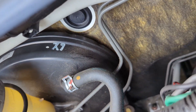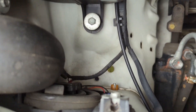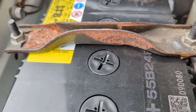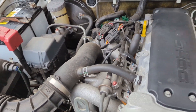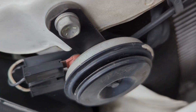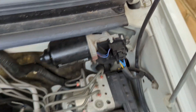Sometimes on UK ones you can see the master cylinder with corrosion on it — nothing here. Every pipe, everything. The only things that let Jimny engines down from Japan are two or three things. One is the hanger that holds the rear wheel — we take those off and repaint them, using a zinc primer. That's always where your eye goes straight away, but everything else in the engine bay looks brand new. Back of the headlights — no corrosion, not even the slightest beginning of rust.